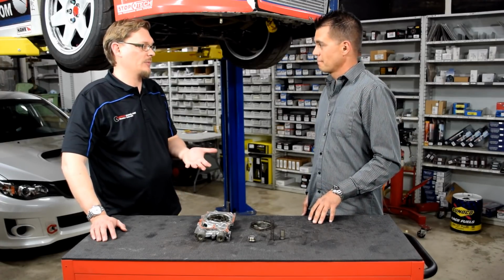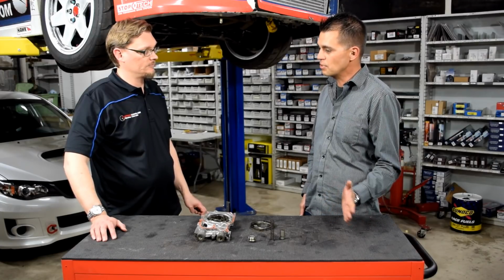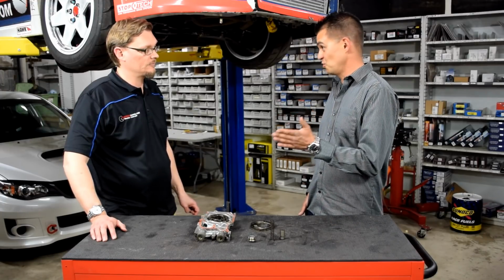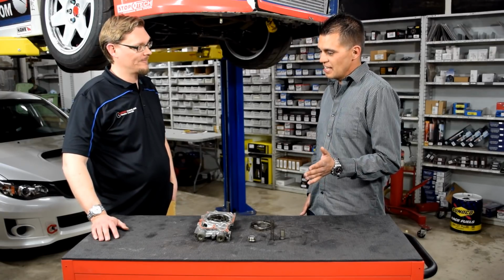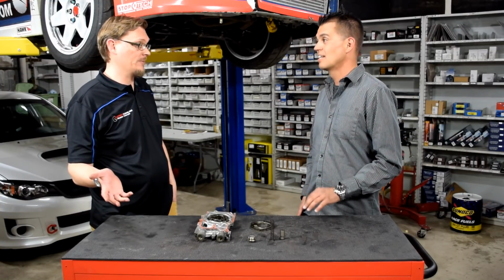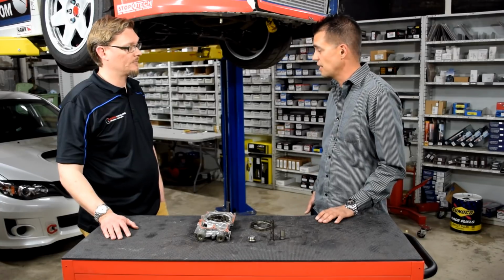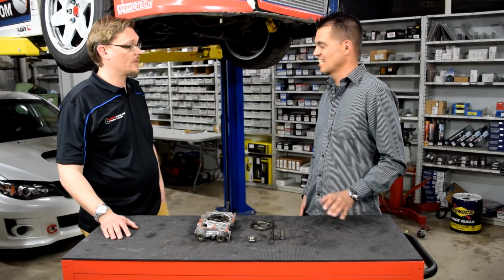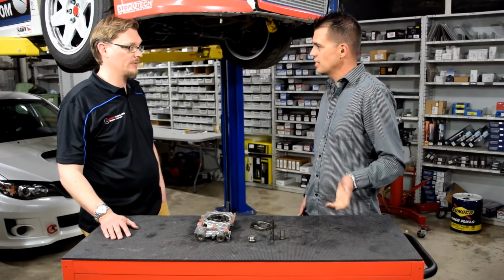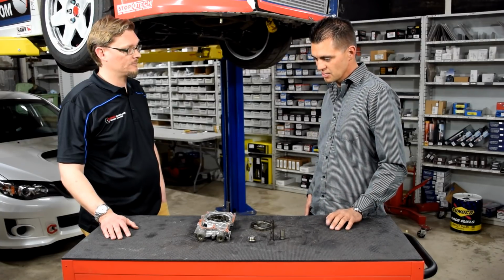Right. So what temperatures were you getting at the track? So at track temps on my car, with the way it's set up with the cooling system and whatnot, getting up to about 220, a little bit above 220. I've never actually gotten to 240 on my car. At 220 on the track, I was noticing that I was getting pressure diving down to 60 psi, which is much lower than it used to be. Much lower, and my engine is an EJ207, so I'm revving to 8,500 RPMs. So of course there's that concern, like, oh boy. I don't think it's concerning as it's not low oil pressure, like 30 psi, but it's not ideal. This needs some research. Right. And so I limited the revs and went back and figured, okay, let's see if we can understand what's going on here.